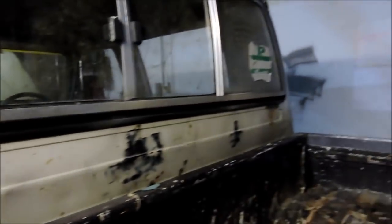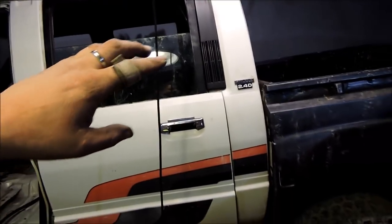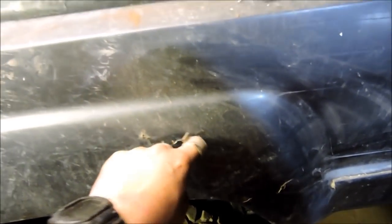Alright, I've been going over lots of various places, like there and along there, over there, and also inside the cab and all there and over there. So what I'm going to do next is the cab. Nice. The cab's in pretty good condition, bodywork wise, ready to paint sort of thing, other than the rust holes. But the well side, the deck, is pretty bad. So it's been bogged up before and it's all sort of starting to fall out and bubble, bit shit. So I'm going to get me flappy disc on the grinder and just try and grind out the areas that are a bit shit, fill them up with bog, and then I'll be able to put the old texture coat over the top of it.